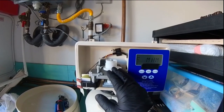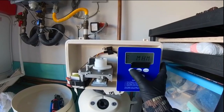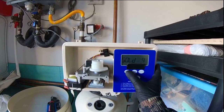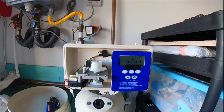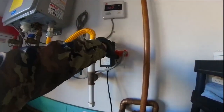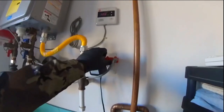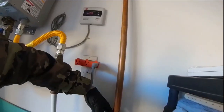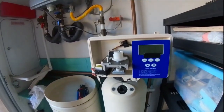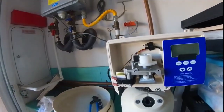It's very important that when you take this apart it's in the home position, so when you put everything back together everything lines up perfectly. Program all the way until you get to the home screen, which is the time of day. Go ahead and unplug it — it's very important that you unplug this when you service it so that nothing moves. You want this to be in the home position.